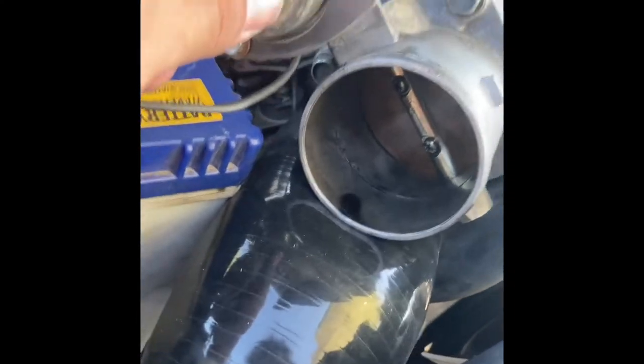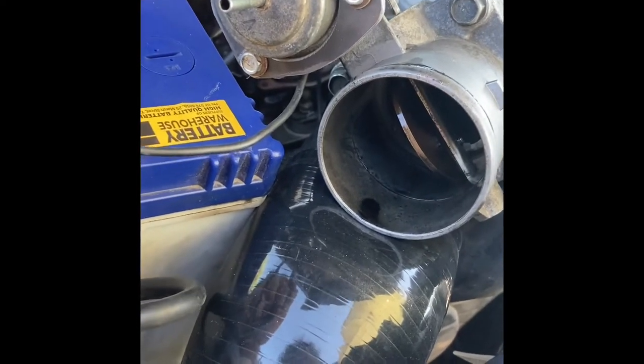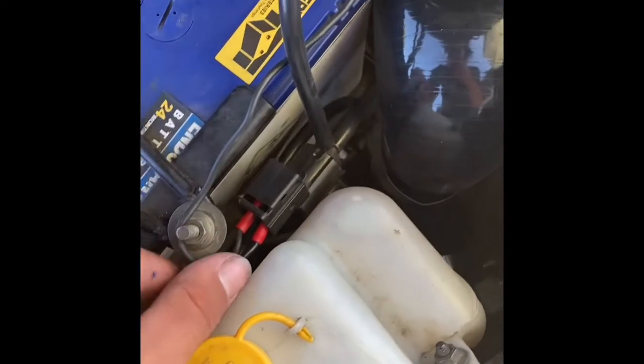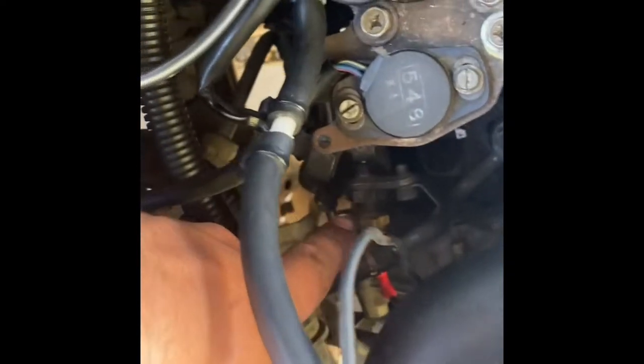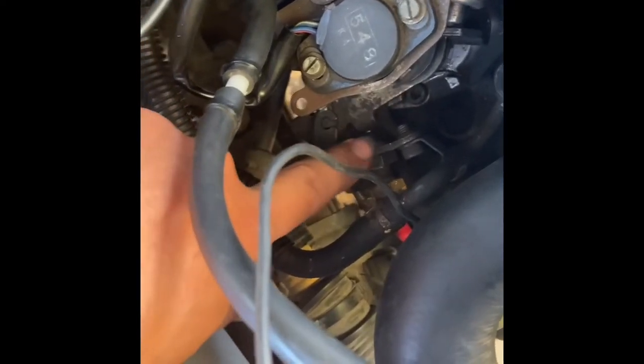At the moment it's got vacuum — I'll pull this line off — and then there's no vacuum in there right now. From the solenoid valve, this goes down to this old EGR switch, which is like a momentary switch. When this is on, you can hear the relay clicking like that, and that just controls the throttle body.